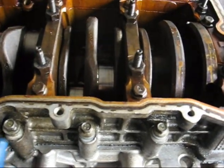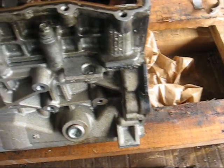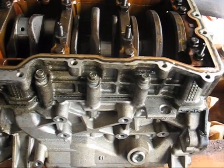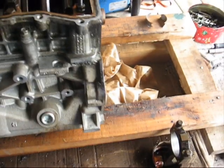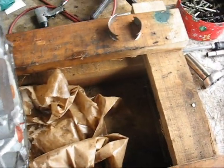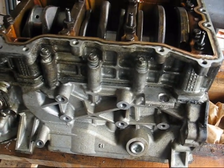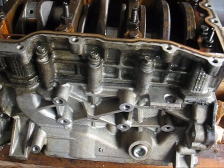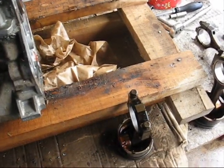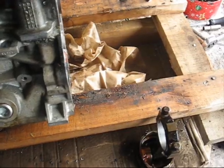Aside from that and being a bit dirty, all these pistons are in pretty good shape, and the engine as a whole is in pretty good shape. You could probably grind the crank, get some new bearings, put it all back together, and you'd be fine — you'd probably get away with just honing the cylinders too because they aren't worn at all. This engine only had 130,000 miles on it and it was in good shape. This kind of failure is typical of oil starvation. If they lose oil pressure, even just for a moment, it'll spin a bearing almost instantly.